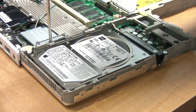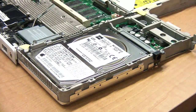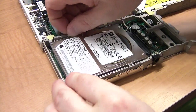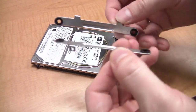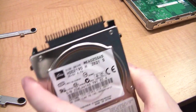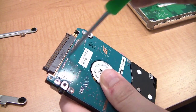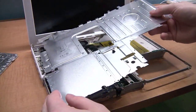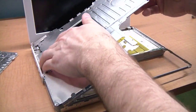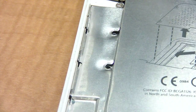Since this particular machine needed a new hard drive, I'll show you how to remove it. Basically, these four screws and then two screws over the interface. You'll need to remove these little brackets and watch how I remove this little interface adapter. When you go to reassemble the laptop, make sure you put the RFI shield back on the left side first, getting the left side down under the little metal lip. The most common mistake is people trying to cram it back on from the top down — that just bends it to pieces.